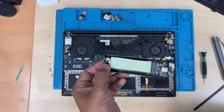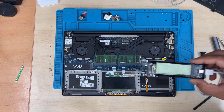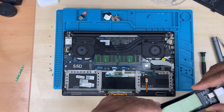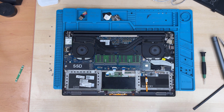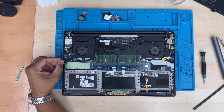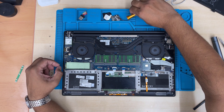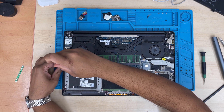Or you can clone it — I've done that separately on a different computer. Once everything is copied, put the thermal pad back onto the new SSD and put it back in place. Please do not connect the battery before you get things sorted. Sometimes the screw is not magnetic — that's fine, you can just do it manually.